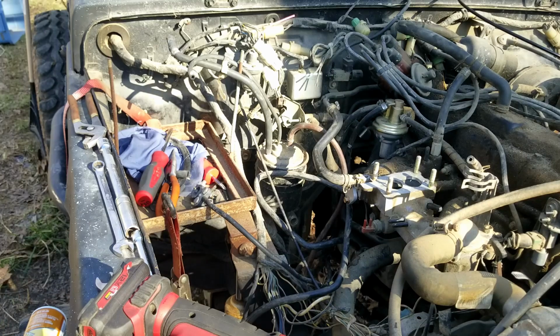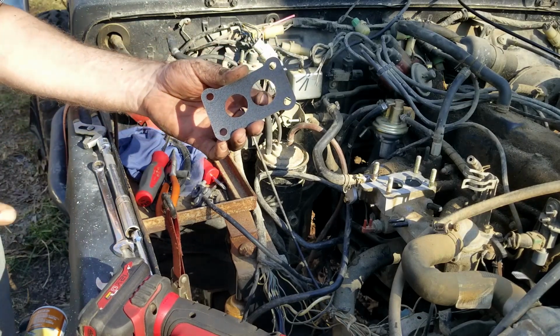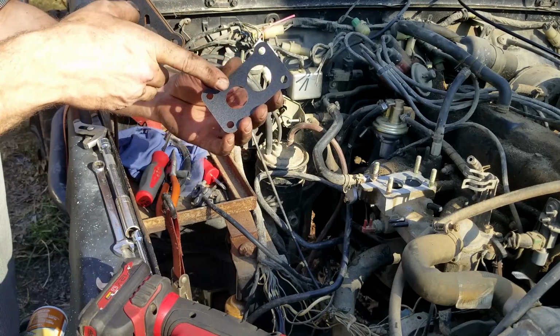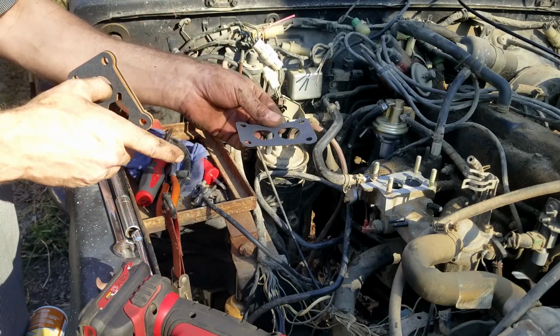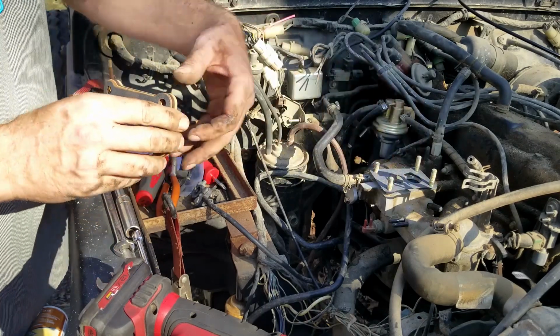All right, great news. You're halfway done. Now it's time to install the carburetor. Installing the manifold gasket from the kit first. It is identified by having no vacuum notch from the bores. The 2 holes are different sizes, and the larger hole is positioned closest to the valve cover, away from the battery. Next, install the new insulator from the kit, with the vacuum notch facing up.